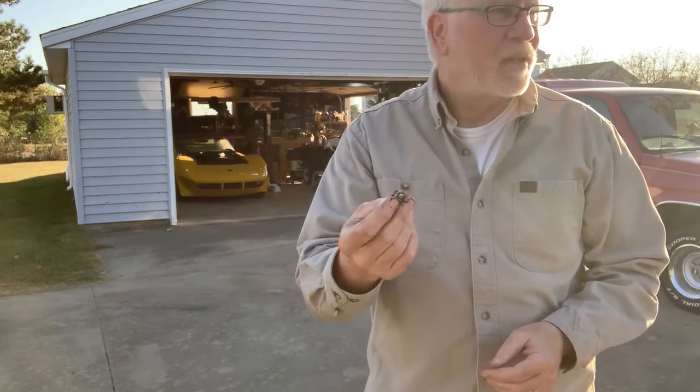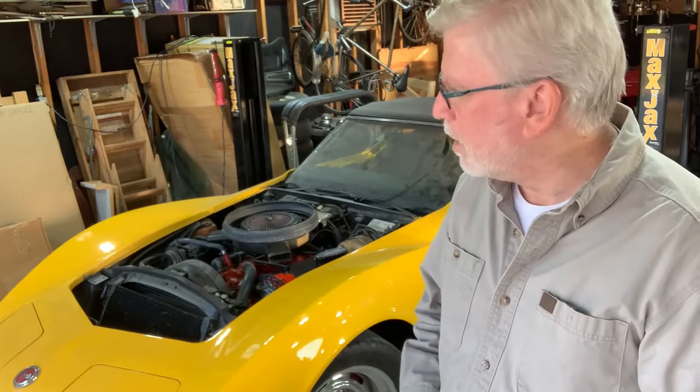This is the second bolt I found on the driveway since I started driving it. I'm gonna go walk the street and see if anything else fell off — I'll let the shakedown continue. I do have power steering now. It's not as powerful as what I was expecting — I kind of thought something like what I had. I wasn't expecting like a Buick power steering where you can just turn it with one finger, but it kind of seems to come and go. And you probably heard some crazy squeal — I don't know if the pump is protesting and that's the belt jumping and chattering. I thought for a little bit that it was some tire rub because I noticed it on the extreme turns. It is nice to get the car out and actually drive it — there's some horses under that gas pedal which I really did enjoy, so that's got me a little bit jazzed.